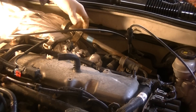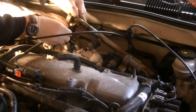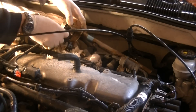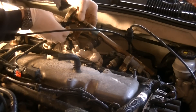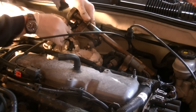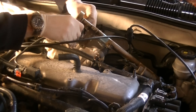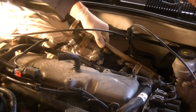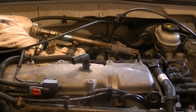There's the o-ring — here's the new one. It would be best to lubricate these with gas or something to help them slide in better. Do the same thing for the rest of the other three, and that's it — just make sure to put the clip on.